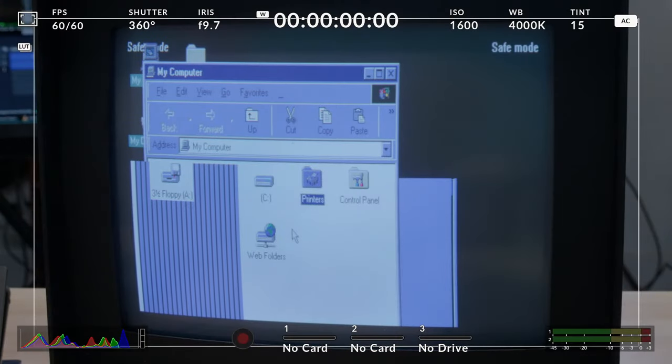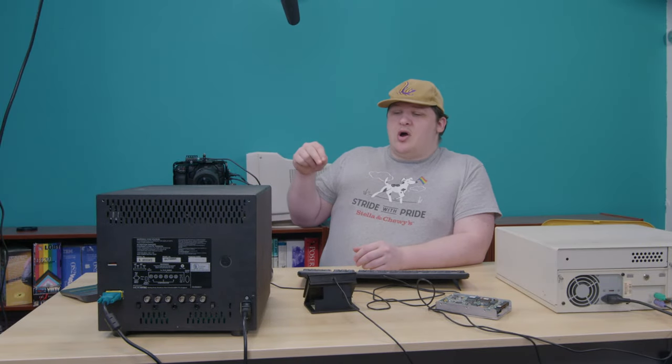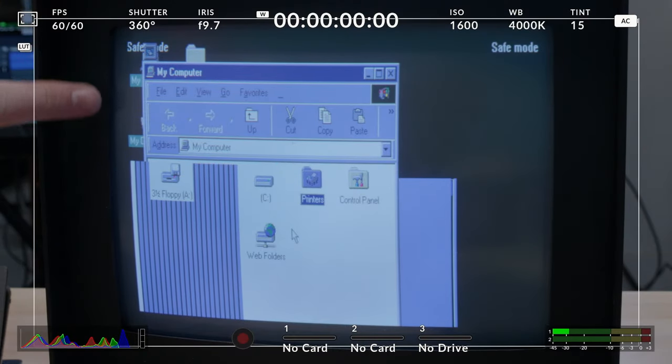Of course, it's not really. You'll notice that there's no taskbar, and everything is stretched vertically. Everything is just a little bit stretched. And that's because what it's doing is drawing 640 pixels wide, which is fine, because EGA's high-res mode does that. But then it's drawing 480 rows of memory vertically. Well, the EGA only has 350, so it basically runs off the end. It just keeps on drawing to memory that's down here somewhere. And fortunately, that doesn't smash anything. It doesn't mess with anything and crash the system.